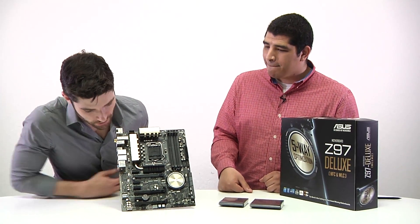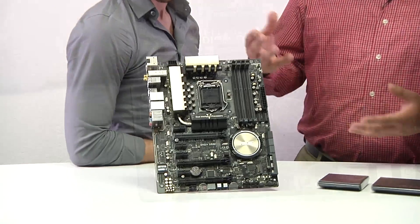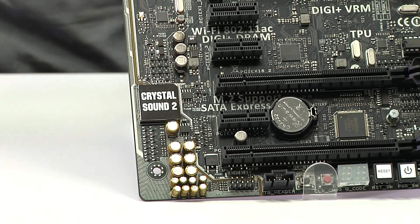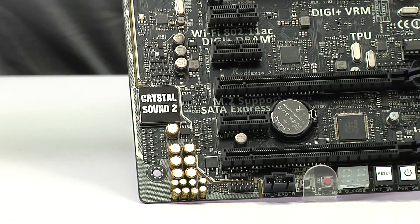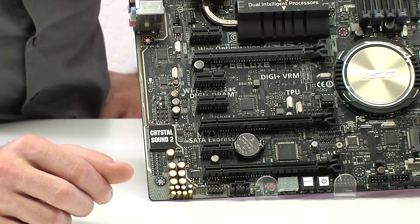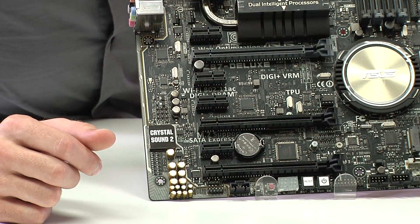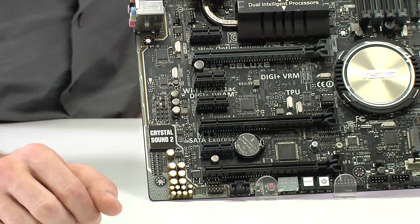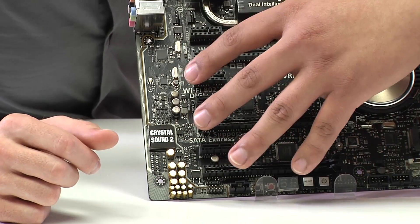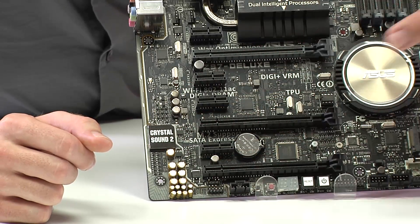One thing I noticed on the board is this line cutting down around here, kind of separating it — what is that? So that's actually one of the new features we introduced on the channel series, but it's been a hallmark for ROG boards for a couple of generations. With ROG, we developed what we called our red line audio design, where there was an LED backlit across that line to show you the isolation path. Essentially, what we did is separate the sound section of the motherboard from the rest of it, because you get things like interference. Some of you have probably plugged into a desktop or notebook and heard a flutter or a hum while browsing. A lot of that comes from all the electrical componentry and layout that can flow over into the audio section. So what we've done here is essentially isolated this — that's the actual sound processing chip — and we've also shielded it with a cover to minimize electromagnetic interference.